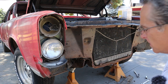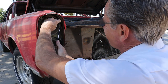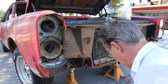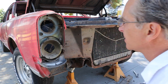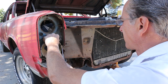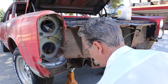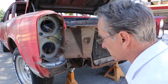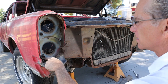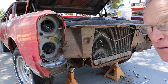All I have to do is get the cans out. Let's see if we can get these cans out — pop the screws out of their slots and hook it off the spring. These adjuster things are plastic back there; they need to be replaced. I wonder if I can get these parts. Hopefully I can — GM used the same parts on all of them. So once we get the fender off, I can lay it on the bench and get these springs out. They are kind of a bear to get out of there, but we got the bulk of it. Let's go ahead and move to the back and get that rear bumper off.